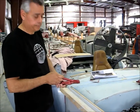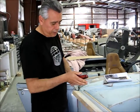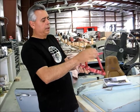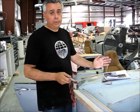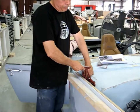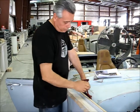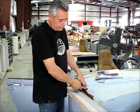All right. I asked a question about the hood, so maybe you can explain how this hood's going to go up. Well, the hood hinges that we have are right here, and what's unique about these hinges, as you can see, is they go up and then they go forward. So this hood needs to go forward first, and then it has to come up, which is pretty tricky, by the way. So what we're going to do is build this in, and when the hood goes up, you can see how it pushes forward, and then we have an air shock that will hold the hood up permanently, for both sides.